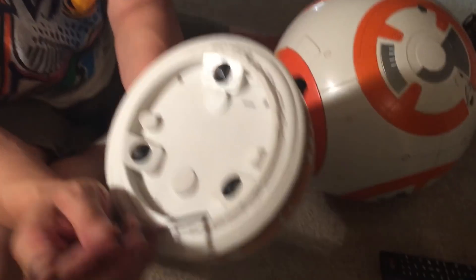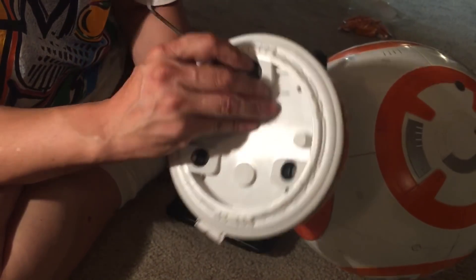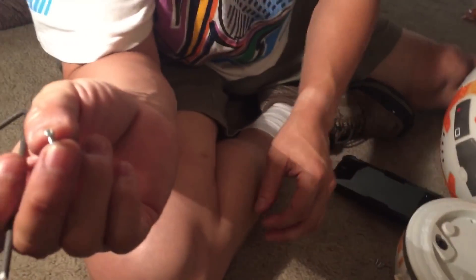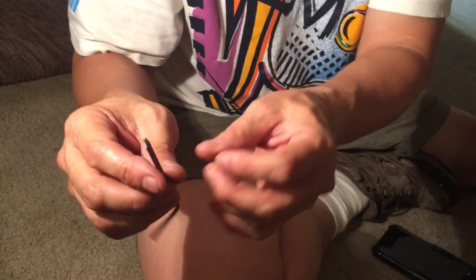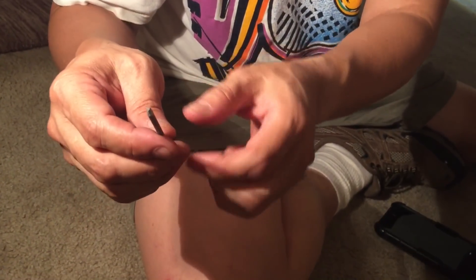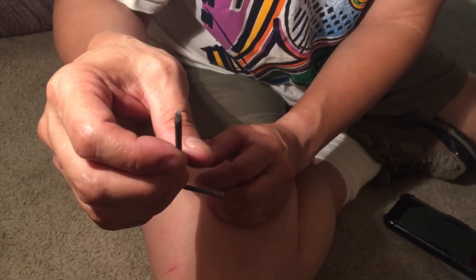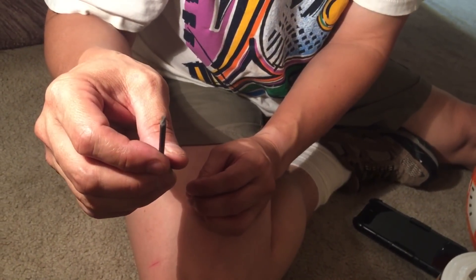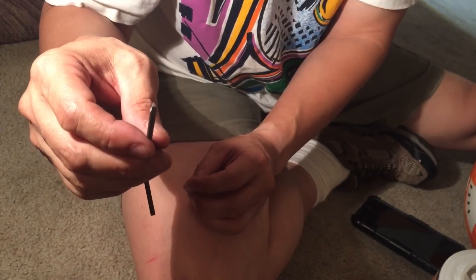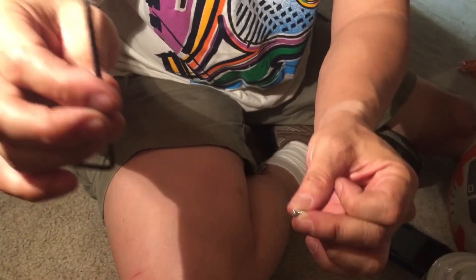What we notice on the bottom right away is there are four screw holes. These screws were triangle head screws, so don't despair — go out to your shed and you probably have some eighth-inch round stock. I took it to the bench grinder and ground out a little triangle, kept making it smaller and smaller, fitting it into the screw until I reached the right size. Easy to make these kinds of tools.